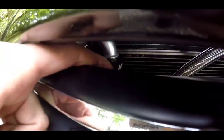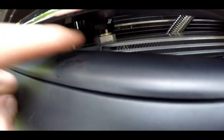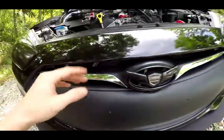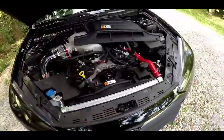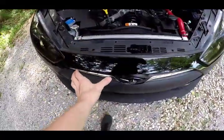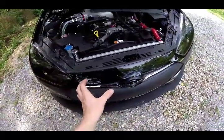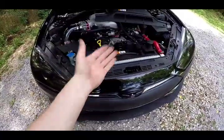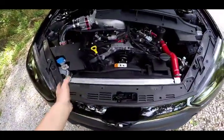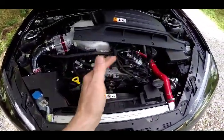These fittings fasten right into the oil cooler itself, so tighten them just a little over hand-tight on both sides. Then fill it up with oil — for me it took about seven quarts for startup. The oil in the oil cooler is never going to consistently drain out when you drain your oil, so that oil cooler will stay full. After the first time, it'll probably be around six to six-and-a-half quarts.